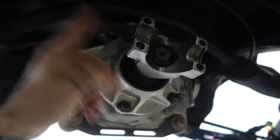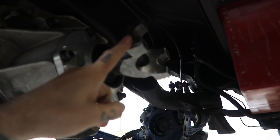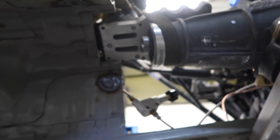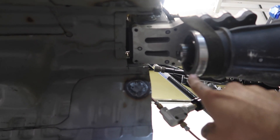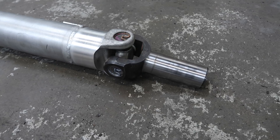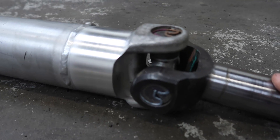You need to know what size yoke you have. If you don't have the yoke yet, be sure to get a yoke size that's going to be able to handle the amount of horsepower and torque that your vehicle will have. Here's the back of your transmission — you have the output spline shaft that comes out of your trans. If you're going to get a custom one, you need to know the spline count and size so the yoke fits. I would suggest matching whatever yoke size is at your diff to what's on the transmission.